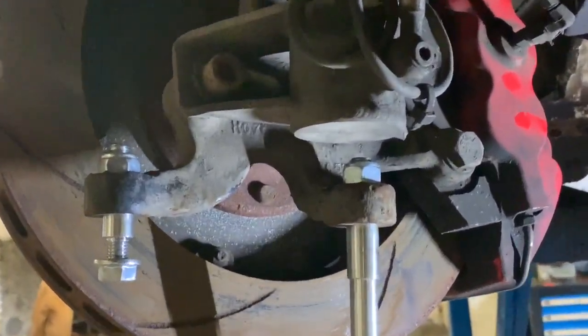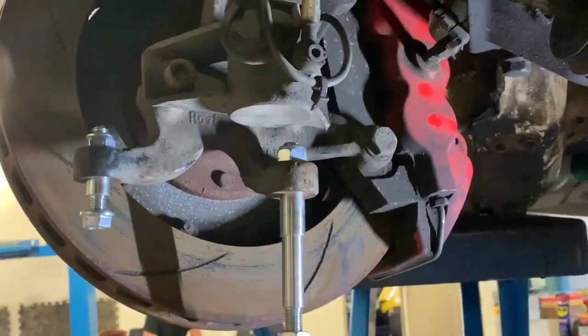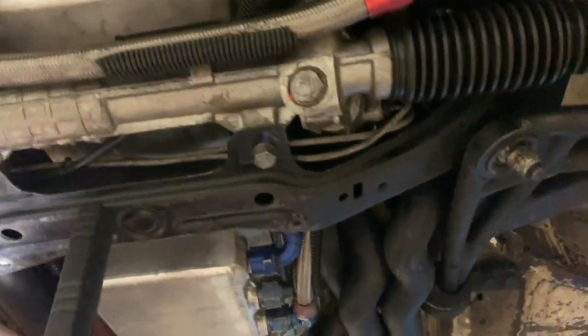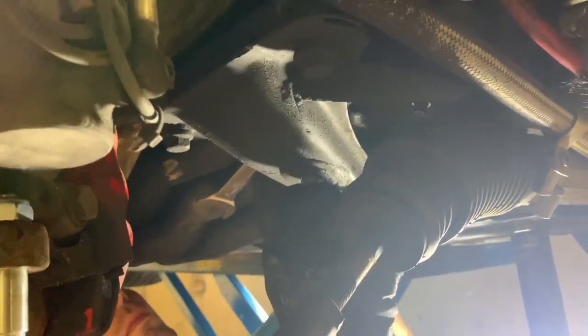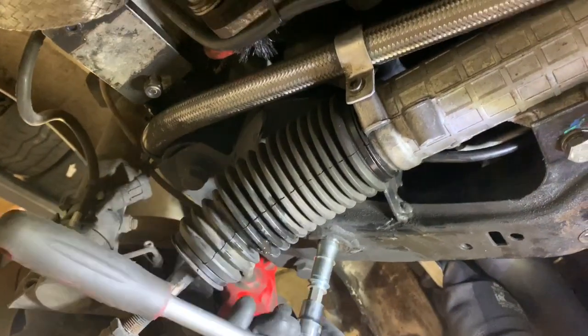Put these on first and put a little bit of loctite on the top nuts — very important. This is a really nice feature because on this car it has a V8, so it has headers on both sides, meaning it's sometimes very difficult to reach the top nut. Weissfab came out with a solution where you can mount the arm from the bottom, so you don't have to undo the big nut that goes on top of the subframe. With five-minute runs and things like that, saving time is very important.